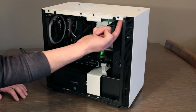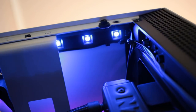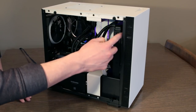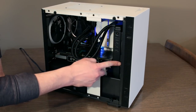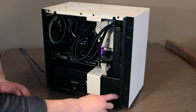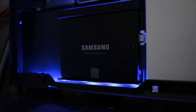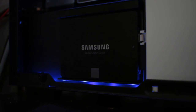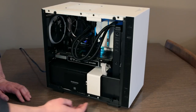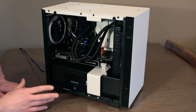Another thing I really like about the front of this case is that along the top there is a built-in RGB strip that plugs into the smart controller in the back. Off of it there is actually a cable that runs down the front and you can plug in more NZXT RGB strips — specifically the NZXT ones — and run one along the bottom. I have another strip from the Hue kit and was able to run one more strip along the bottom. It's nice that you can just plug straight off of it and it has a connector available without needing the NZXT Hue in the back of your machine.